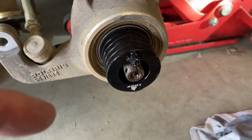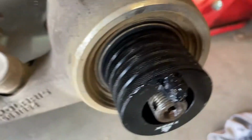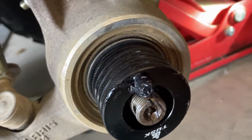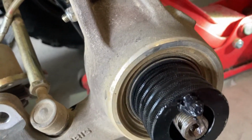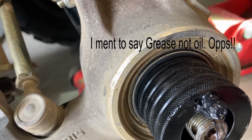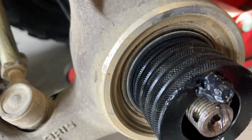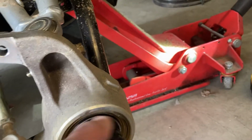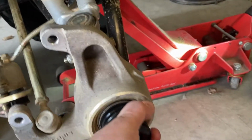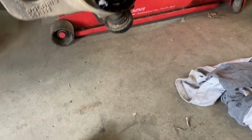All right, so I squeezed this thing, got to about my sixth pump, and it actually started getting tight, like it didn't want to push any more grease in. I tried to almost force the seventh, and I stopped because I realized my seals are probably good, and it's full of grease, and there's no more room. Otherwise, it's going to blow past the seals, and I don't want to ruin my seals. So I can't fit any more in. We're going to see if we can just slide it out. We're probably going to have to move the axle again from the backside and give it a wiggle.